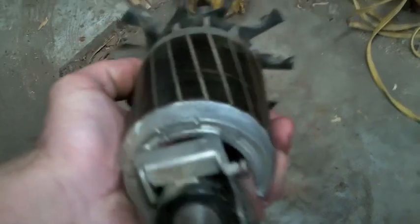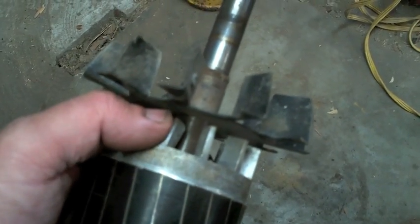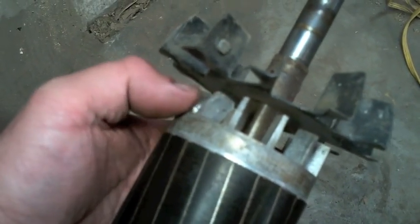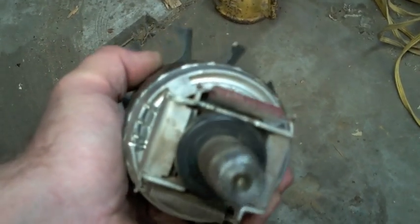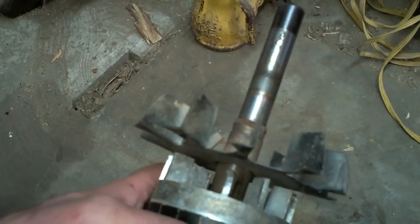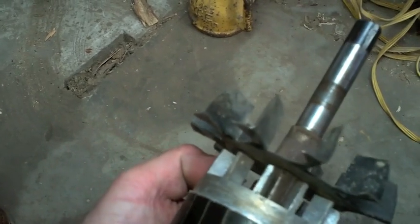Inspecting and cleaning the armature — just brushing it off — I discovered something I'd overlooked. That top fin is missing and this one is bent in, so something hit it hard. I'm not going to make any attempt to straighten these; if you try to straighten them you'll break them off, guaranteed. It means this motor will always vibrate to some degree, but it's just a generic cheapo chunky old used electric motor. It'll run just fine with a little bit of a buzz.